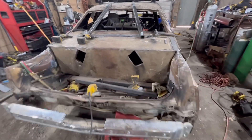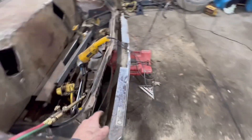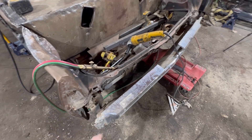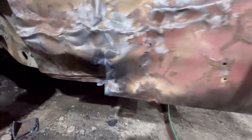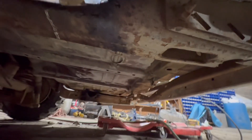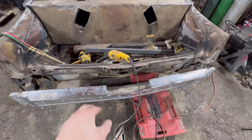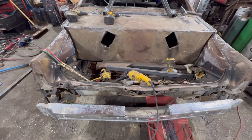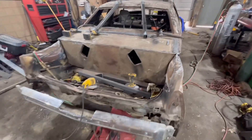Alright, so we just strapped the trunk, put the window bars back in, got the washers on. Next step we're going to collapse the bumper and do the bumper strap. We got this cut and beat over a little bit, and we got the triangle cut out of the top, so we'll smash this in, give it a bead around it, and then do the bumper straps. Then move on to either putting the engine in or bolting stuff down inside, so stay tuned.